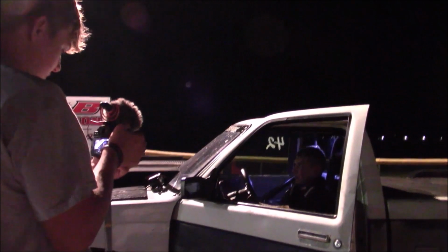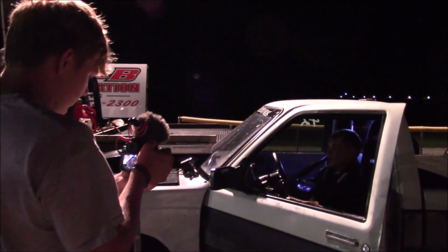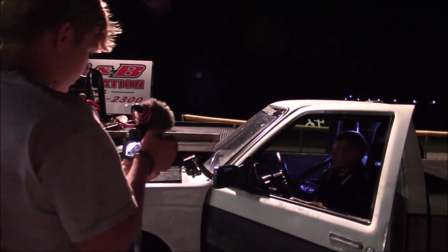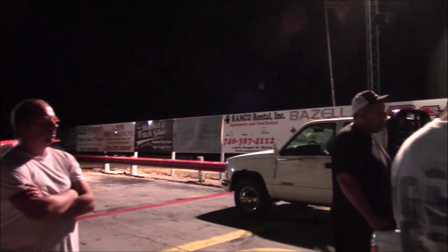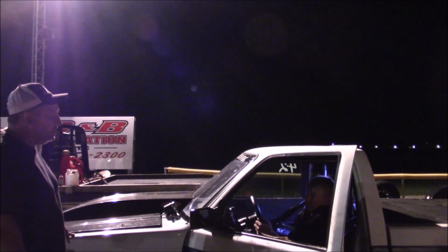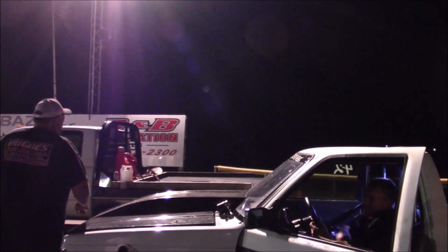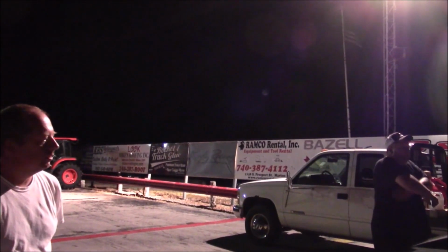I feel like that was way faster. How did it feel? It felt pretty fast. Like it didn't spin, it just blew through. It did come on pretty late, so the 60 foot could be right. It came on at like 40, 50 feet probably. So maybe that's why the 60 foot doesn't show it. I tried leaving on less boost there, so it came in a little later. It was stuck better all the way down that time. It didn't spin. It sounded like it was spinning, but it wasn't. Front suspension was topped all the way out. It just looked a lot better. Yeah, it looked really good.